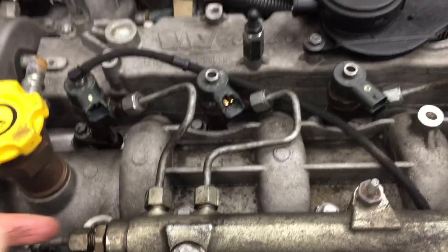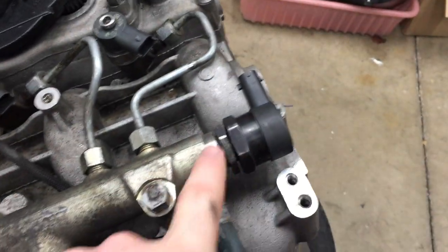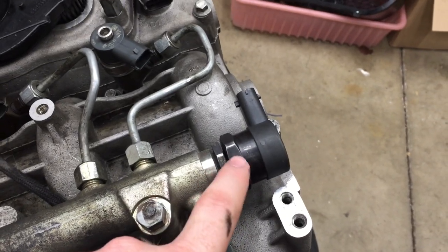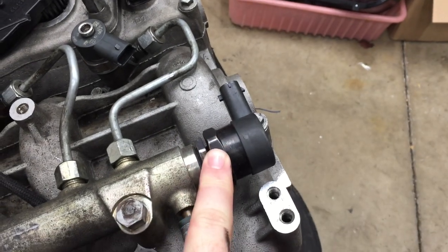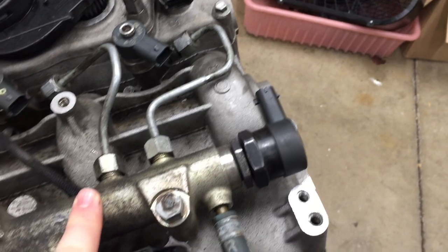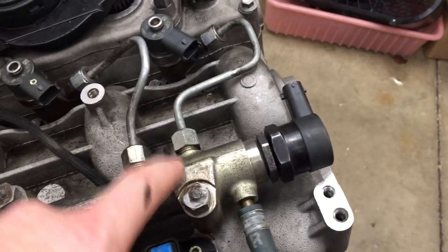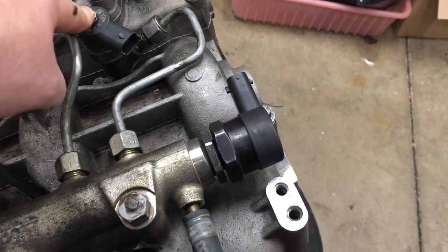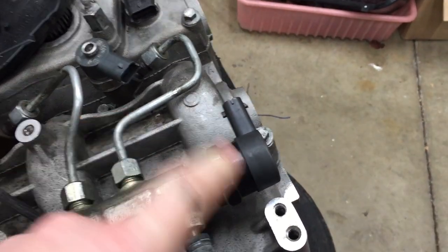Fuel is coming in and going out to each injector as needed. This is like the fuel rail pressure regulator. This little solenoid can also go out, and if this goes out, we don't maintain pressure in the rail. So we might have volume coming in, but we don't have fuel pressure to actually inject into the engine. If this goes bad, you won't start.